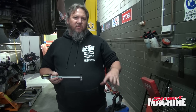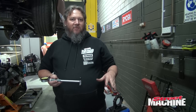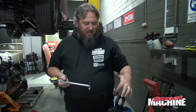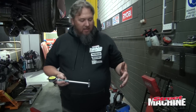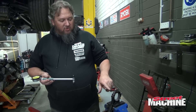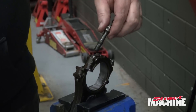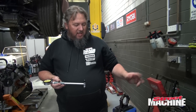If the diameter stays the same, you're right to go — just put the rod bolts in and torque them up. If it significantly changes the diameter, you know you've got to go down to your machine shop and resize them. Everyone's saying new rod bolts definitely means resize, and you're right — if the rod bolt goes through the whole thing, then definitely 100%, because it distorts the actual cap when you press the bolt into place. But these are a little bit different. The cap screw just screws directly into the rod itself — it's a different setup, no nuts.